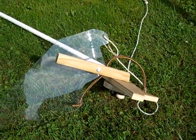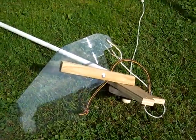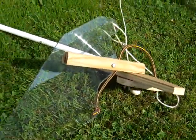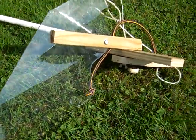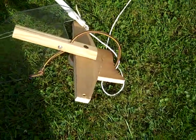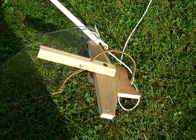Next I had to make some type of steering assembly or rudder for the boat. I tried a couple of different ideas, but for the actual rudder itself I used a piece of Lexan, about 3/8 inch thick, some plywood, some pieces of oak, and a piece of PVC pipe for the steering mechanism.